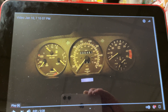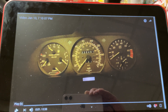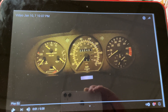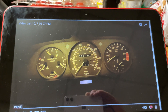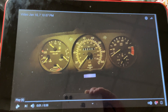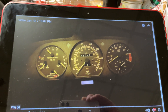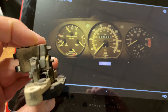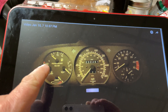The temperature tonight was 29°F; the coldest one I had today was about 24–25°F. It didn't make any difference — it started right up every single time. None of this starting three times like before. The only difference from the last time you watched that video is that I cleaned the contacts on the fuel pump relay when I had it on the bench, because it was making poor contact with my test clips.